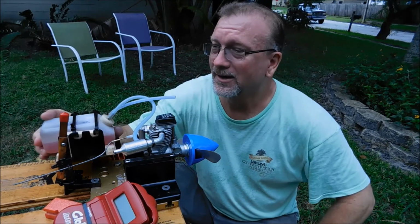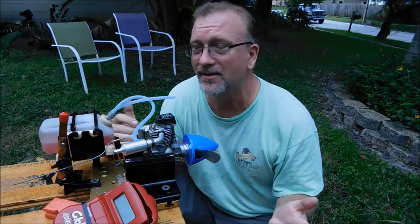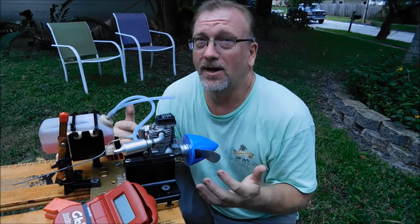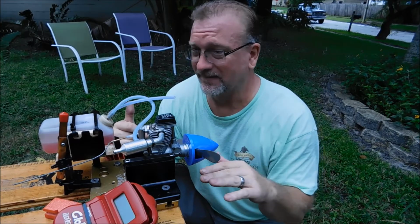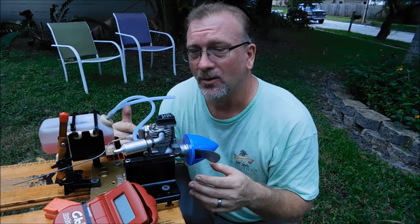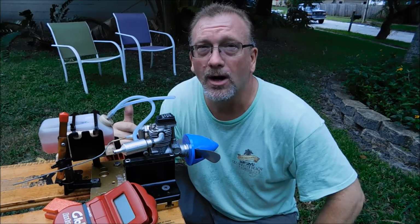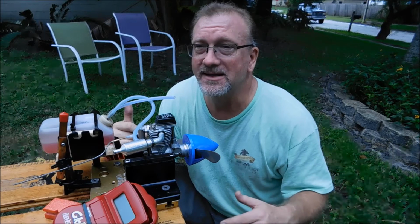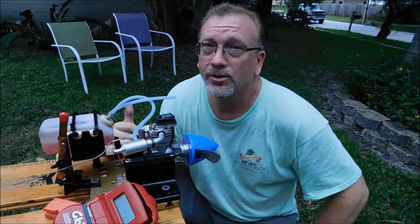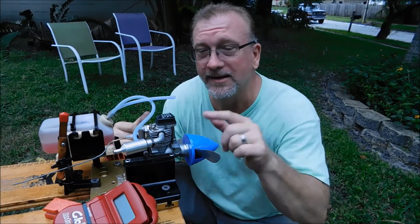So the funny thing is that in a pinch, if the world goes all to hell and we quit making nitromethane fuel, but we still have denatured alcohol and Klotz, you could actually still fly your planes on this stuff. Now, obviously, this is the first time I've ever done this. I have no idea what the long-term effects on engine wear or corrosion would be, because quite honestly, I'm not sure if that denatured alcohol has any water in it at all. I really couldn't find out. The MSDS sheet says there's a percentage of unknown or undisclosed stuff, which could be water. I don't know. Obviously, that wouldn't be good, but we did prove here that this will run, at least this engine. Now I'm kind of excited.